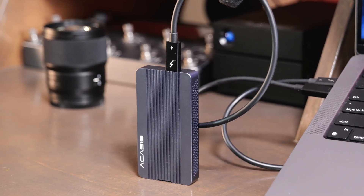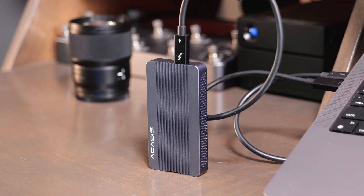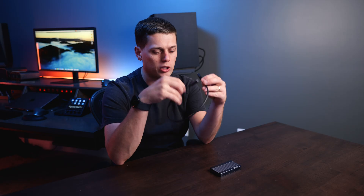This is a nice metal enclosure — it feels really good and has a sleek design. The metal does a great job acting as a heat sink. Whenever you start using this for a long time, especially in Thunderbolt mode with the included Thunderbolt cable, it will heat up. Acasis includes two thermal pads in the box that you can put on either side of the SSD before inserting it, which does a better job at dissipating heat.